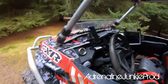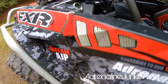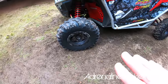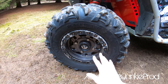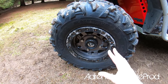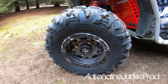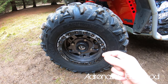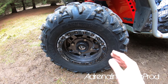I mentioned the infrared belt temperature gauge — it's made by Razorback Technology, a wicked American company. Wheel bearings are a hot topic in the side-by-side world. In the Polaris world we get our chops busted by other brands — 'oh you can't keep a wheel bearing in a Razor.' You've got to grease it with a wheel bearing greaser and good quality grease, and run an OEM bearing. Recently, in the last year or so, Polaris has come up with an updated bearing design that runs a metal sealing ring instead of a plastic one — it's a slightly upgraded design — and people have been having a lot better luck with those.